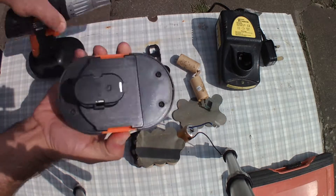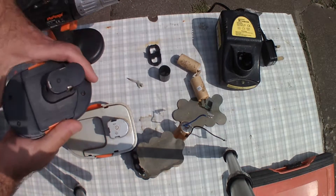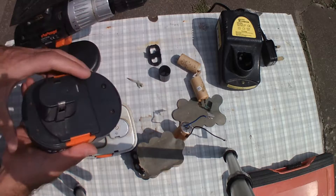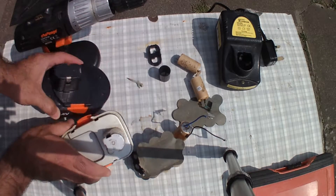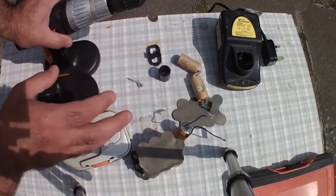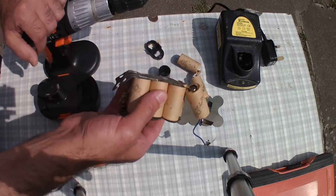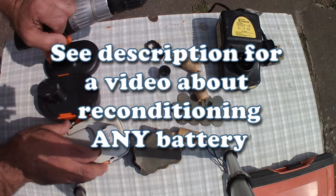The battery heads don't match, so you can't fit the same charger — whether the old charger or the new charger, they don't fit each other. What we want to do is use the current casing but with the good batteries. You have to customize it — move things around. Sometimes it's easy, sometimes it's difficult, sometimes it's almost impossible unless you have a spot welding machine to detach and reconnect with new plates. I didn't have a spot welder and didn't want to mess with that.